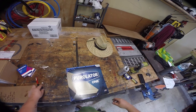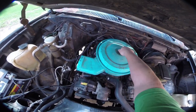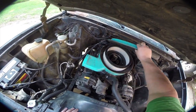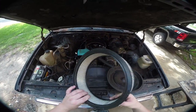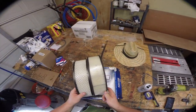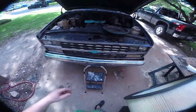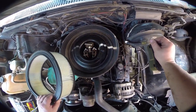Next task is some low-hanging fruit — I'm gonna change out the air filter, part number A591. Looks like somebody beat us to it; this thing is pretty much perfect and the previous guy preferred STP everything. You can see the difference — this one's a little bigger. It's one of those things where I already bought it so I might as well replace it. You can look in there and see the TBI — two big old fuel injectors just dumping fuel down the gullet.